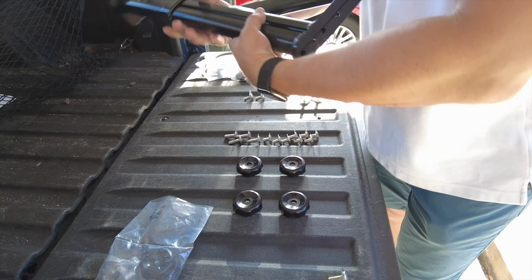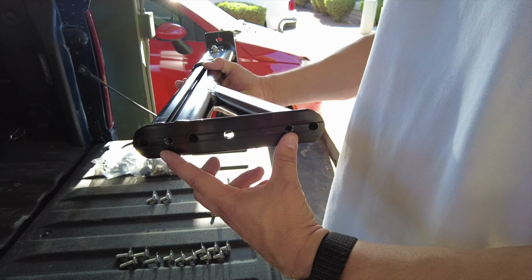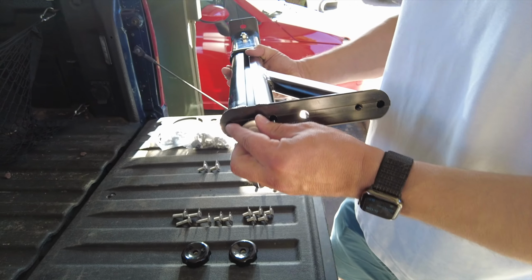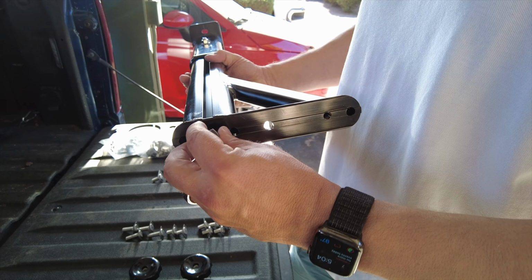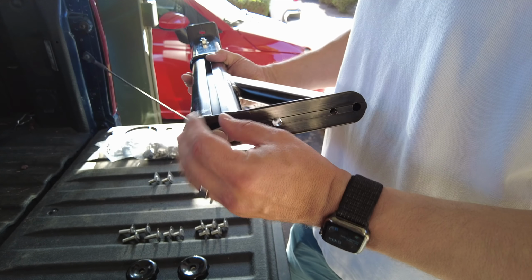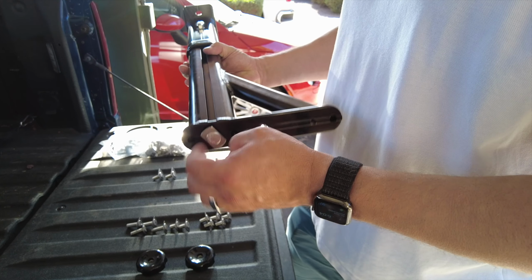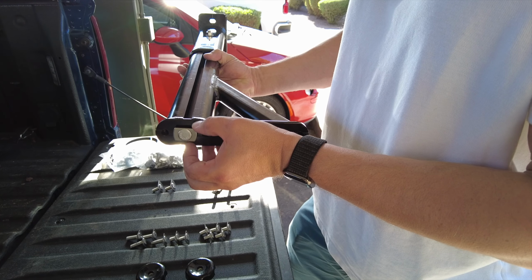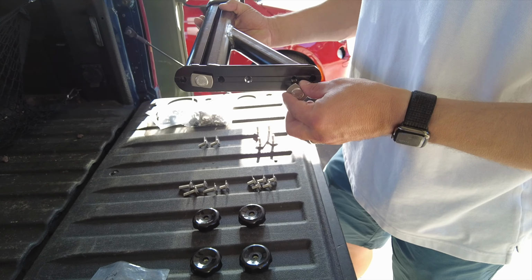The bottom of our AngryElephant Upright has a series of holes. Two will be threaded, okay? Those two threaded, we're gonna take the small leg bolts and you're gonna screw those in there. Hand tighten is fine. They won't actually tighten all the way, and they don't need to. Once they go into the rail system, if you try to tighten it down all the way, they'll be sideways. They're actually going to need to be kind of horizontal to the bar there. And then we'll do the same for the front one with the short leg bolt.